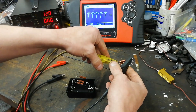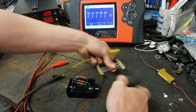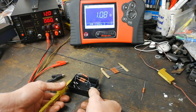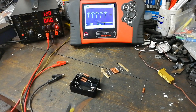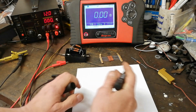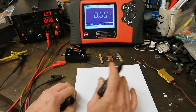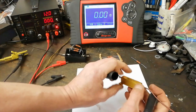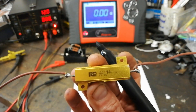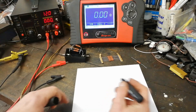All resistors have a tolerance so you may get a slight discrepancy in them — there's 3.23 on that one there, very little difference. Apart from this one, which is 15 ohms and it's rated at 50 watts. But that's far too high a resistance for what I want to do here.